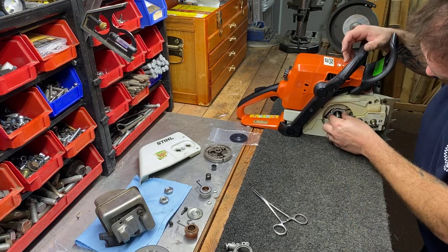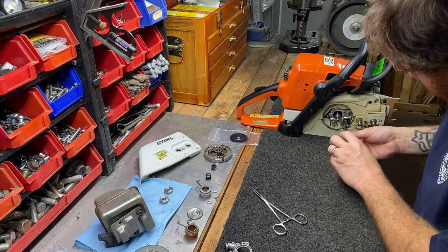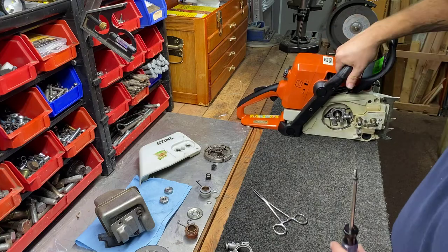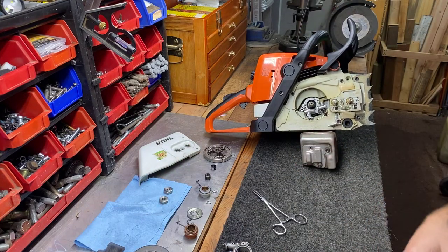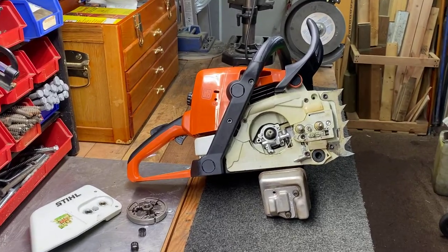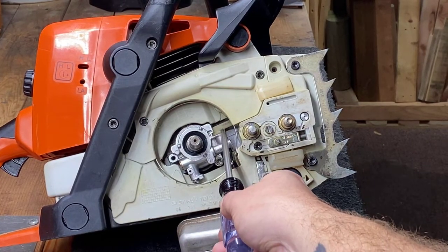The oil pump - once you get it, you feel it settle into place. We're going to take our T27s here, our little guys, get them started. I already had this all cleaned up from the prior videos. So, T27 here, there's another one here. This is the plastic vent I was just talking about with the O-ring - it leads to the front. Here's the oil line.